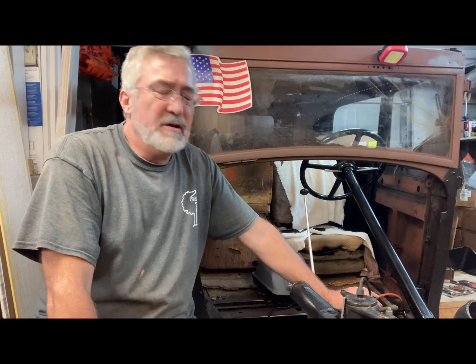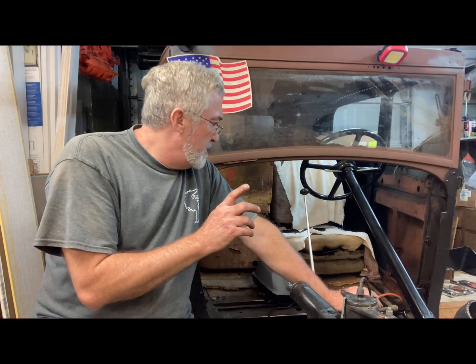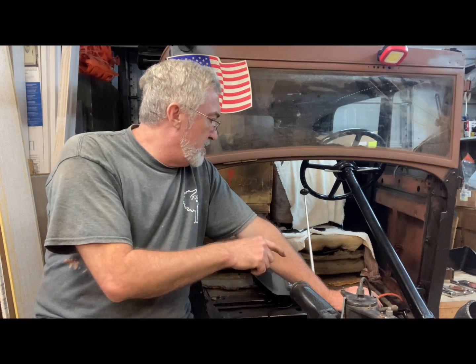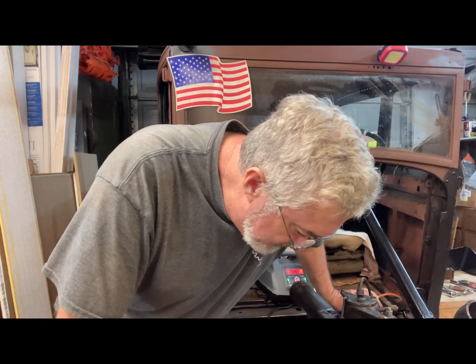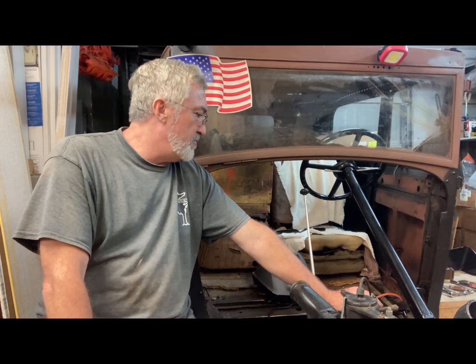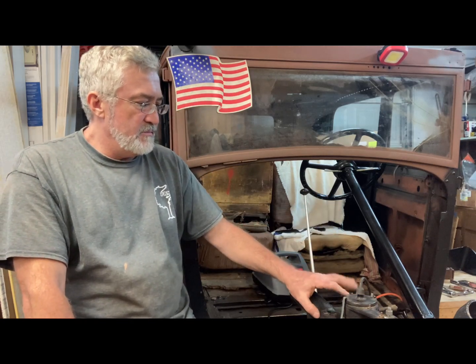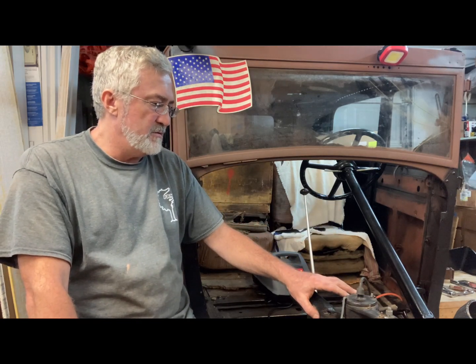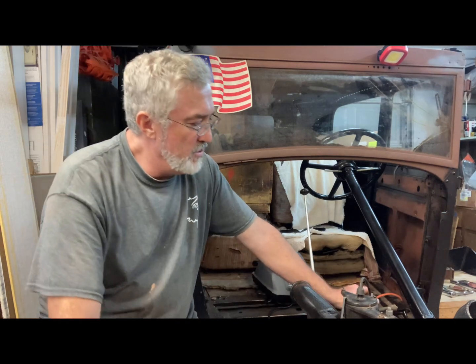Okay, I'm gonna start looking into the distributor on this. I got the battery connected, battery disconnect switch, and I went ahead and mounted the modern fuse on there to get ready to connect the coil and set up the ignition on this. I got it to where starter's on and it's spinning over.